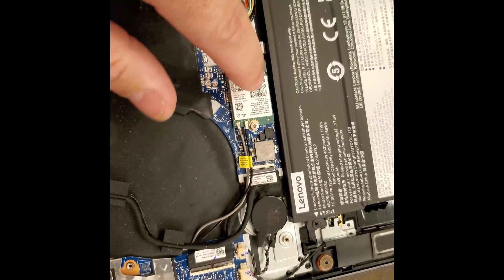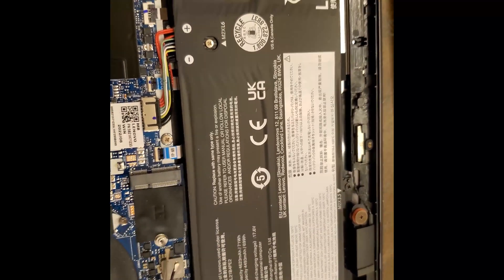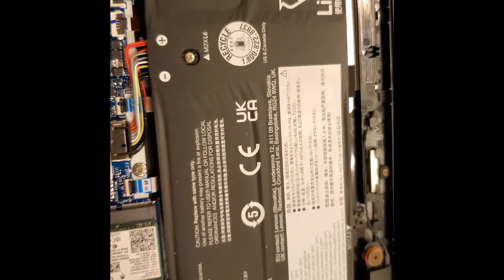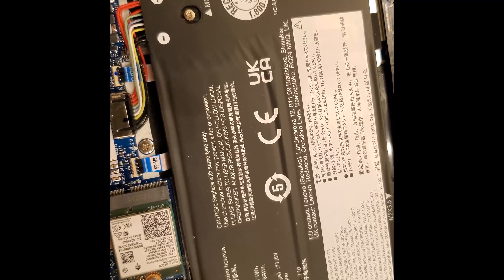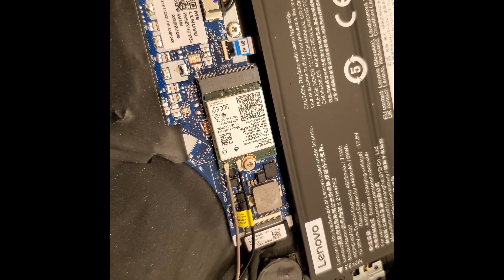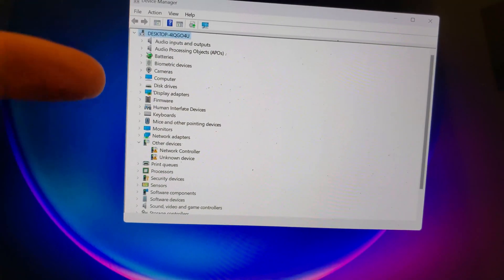I'm just going to hook it up exactly the same and transfer it directly. I'll leave the old card screwed in while I pop the antennas off — it's easy to come out. The old card just comes out like that, and the Wi-Fi 7 card just inserts in. Pretty easy. The new card is in, and connecting the antenna cables back up — I'm not using the cables that came with the card. It just presses on there, doesn't take much at all to snap on. It's installed.